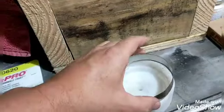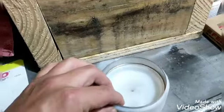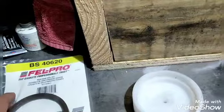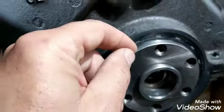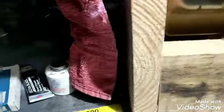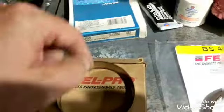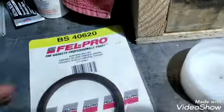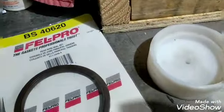So this tool - you can use it to put the rear main seal on, or the repair sleeve. The repair sleeve is what I use on old engines with a lot of miles on them. They'll have a ridge or groove cut in right here where the seal rides, so the seal won't seal up real good. They usually come with a little bottle of red Loctite - clean the crank real good, put this on, and wang it on with the tool and a dead blow hammer.